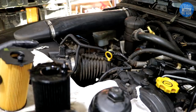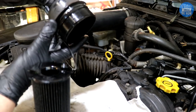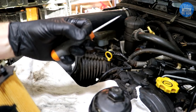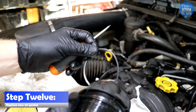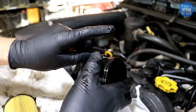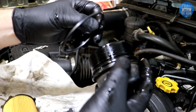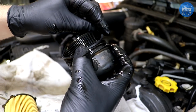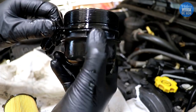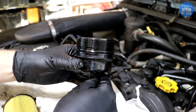Time for our lovely new filter — let's have a quick look at the difference. Here's the o-ring. We need to remove the old o-ring so we can install the new one. The easiest way is just grab a flat-head screwdriver and pry underneath it — off she comes. After 5,000 Ks they're normally still pretty good, but it's best to replace it. Get it into the little groove, getting one side started and stretching it like a rubber band, working your way around. Make sure there's a little film of oil on the o-ring itself when tightening, and make sure there are no twists in the o-ring either.